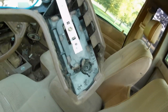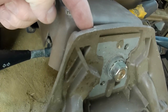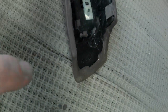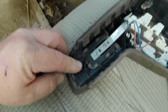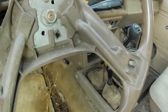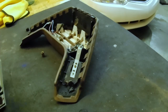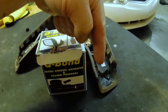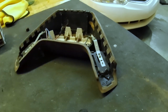It's pretty obvious what the problem is. It has hooks there and there, and those hooks hook here and here. On the bottom here and here, it's got places that are supposed to have screw bosses — but those screw bosses are totally broken off. Let's pull those out and glue it back together. We're going to use Q-Bond to fix this. Link down in the description to Amazon for this stuff. If you've never used this for plastic repair, get some — because it is that good.